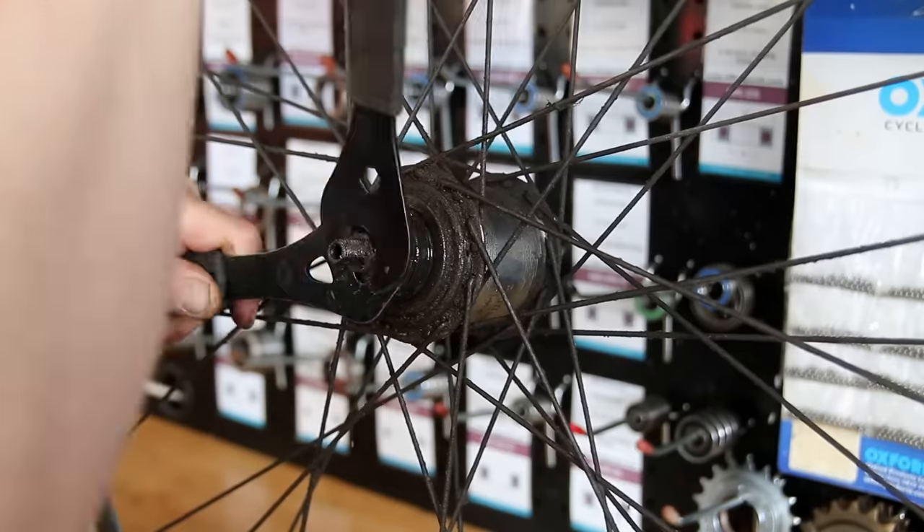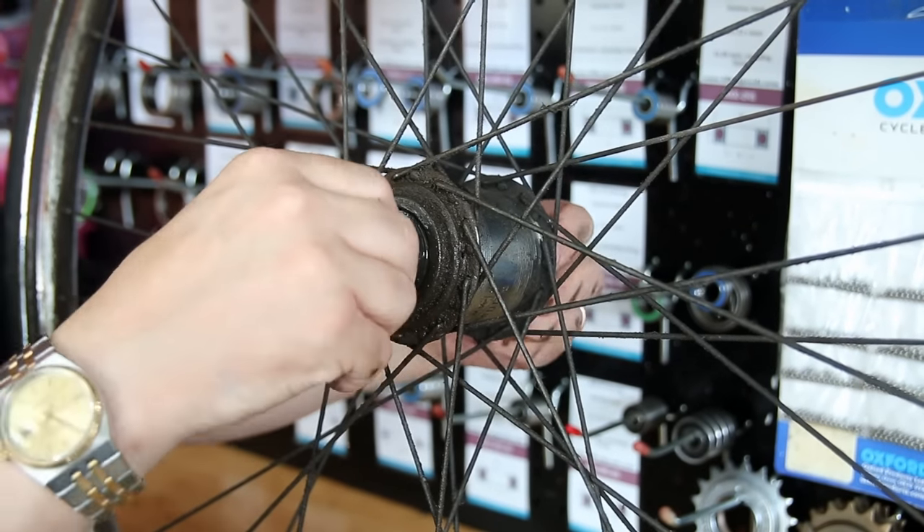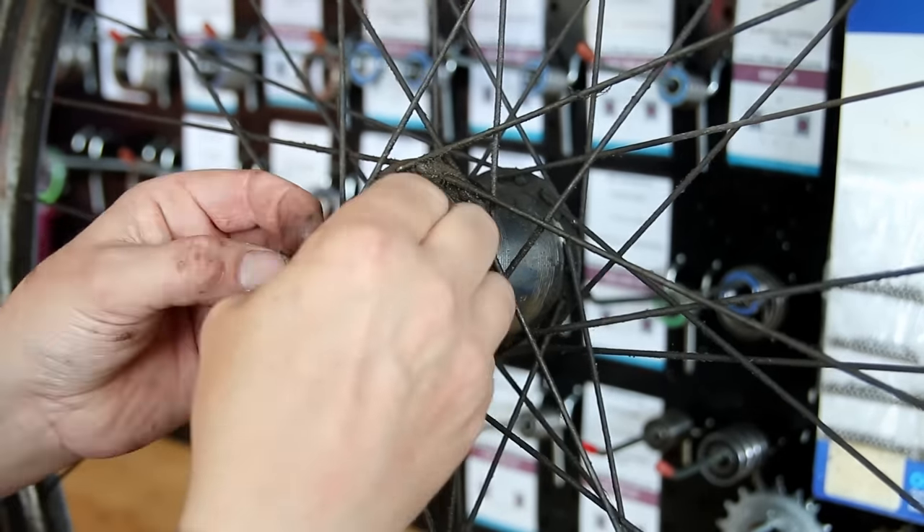Next up is the hub. We're going to fully strip this down completely to component form — you'll be intrigued at how many components come out. It's an ingenious system. Here you can see the bearings and how that grease has thickened off. Any grease on a bike should be very buttery to the touch, almost like butter itself — with debris and age it thickens up, which is why these components need servicing.